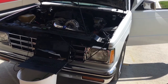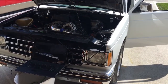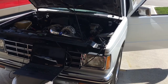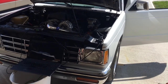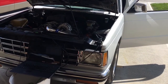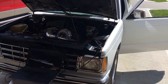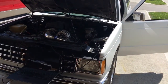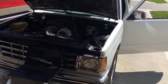Basically, the original changes I made to the tune were just small changes I got from watching a tutorial from Matt Happel on the Sloppy Mechanic on YouTube, talking about basic changes he does when he starts to dyno tune stock vehicles. These are some of the parameters he automatically changes — speeds up the power enrichment, changes the throttle opening percentages to have power enrichment come in sooner than factory, which is like 4,800 RPMs.